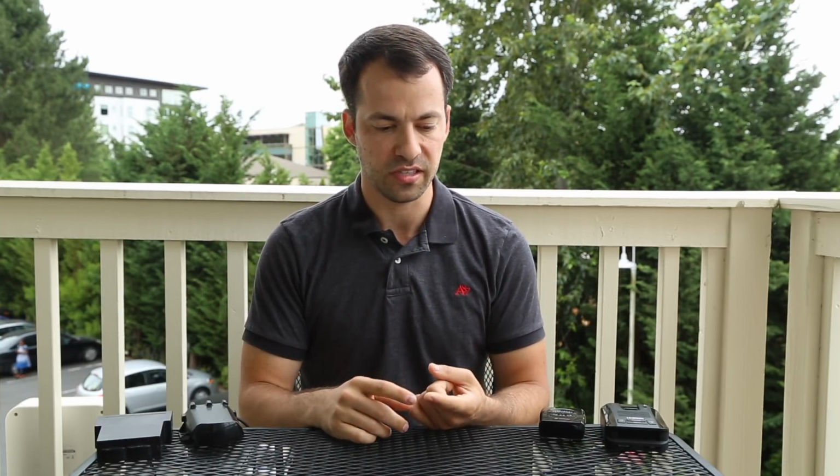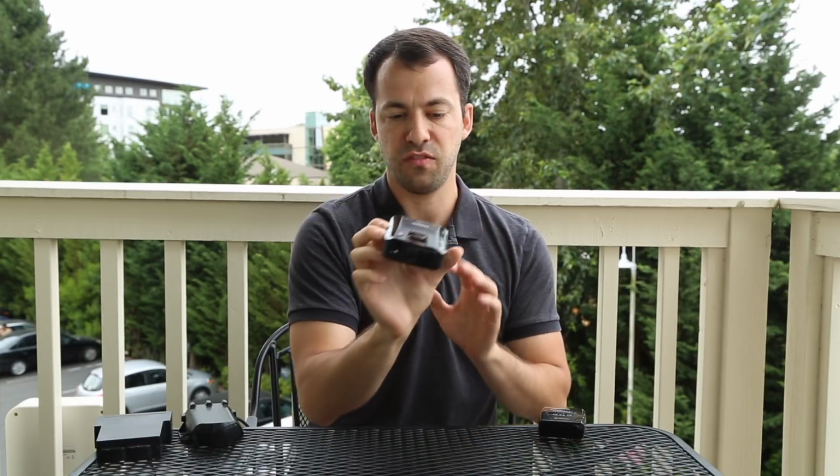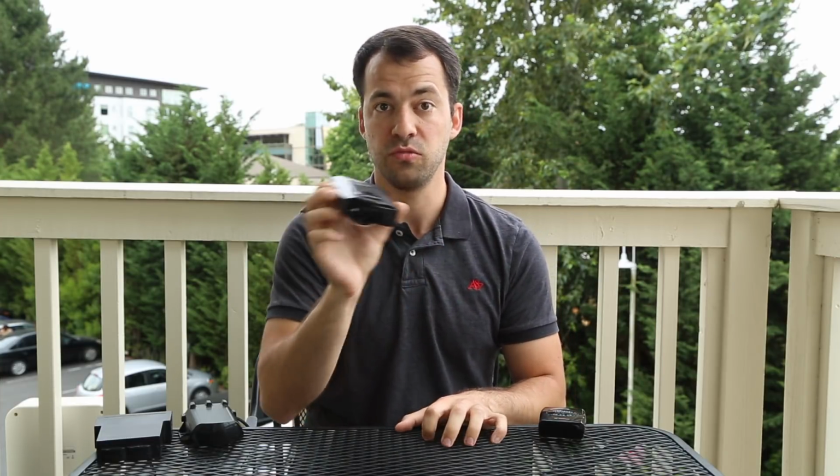You'll see this in vehicles like certain Mercedes, Porsches, Land Rovers, some Teslas, etc. Some vehicles, not others. If this applies to you, you're not going to be able to use a windshield mount detector at all, because your windshield is going to be blocking so much of the signal that it's going to be almost useless here. You can actually test this yourself if you're not sure by taking the radar detector and maybe putting it behind the windshield and then moving it out the door so the windshield's no longer in front of it, and seeing if the signal strength gets stronger or weaker.